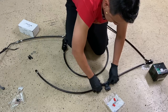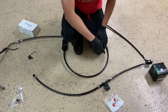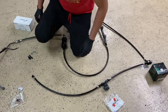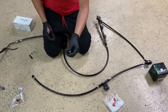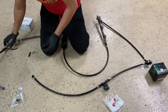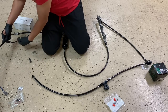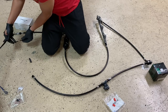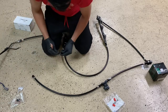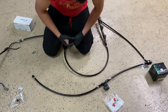This will pretty much read how much ethanol or gasoline is in the tank, so you can run 91 or E85. That goes all the way to the return line at the stock piece. What I use is a quarter-inch to a dash-6 fitting with a hose. You want to put this right next to the return line so there's no E85 touching the rubber at all — keep it as tight as possible.